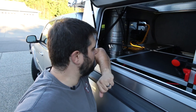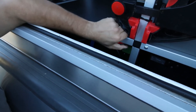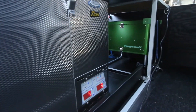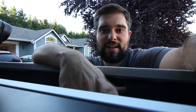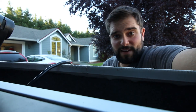The last thing I have to show as far as the power system goes is where the fridge is plugged in. I have a socket wired in right here with a cord run all the way back to the fuse panel, secured along this edge with cord keepers and going into the back of the fridge. When I extend the fridge out, this happened to be just the perfect length to allow enough slack to not get bound up in the fridge slide but also allow enough length to fully extend the fridge. This fridge stays in here 24-7 for the most part. I also have the regular AC plug that this thing comes with plugged in so that when I get home, I can just run an extension cord out to the truck, not have the draw on the battery from the fridge, but also keep the fridge powered and ready to go.